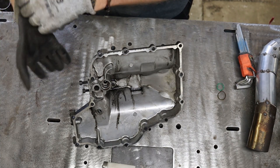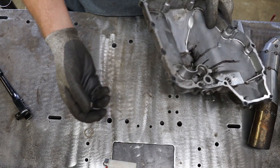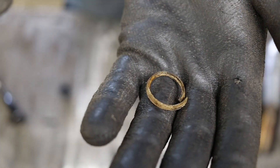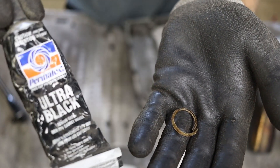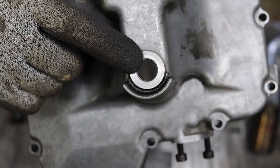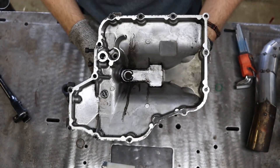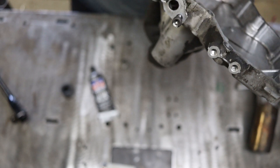I did have a bit of a surprise here. That is the oil pan, and when I unscrewed the bolt I found a small surprise — it's kind of a homemade sealing with what's probably a gasket maker. This is not a good sign. I found out that the threads are completely stripped. So I'll take care of that, then put the oil pan back on, and then I'll be able to complete and finish the cooling system for the oil.